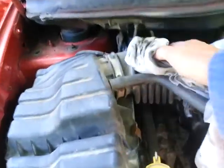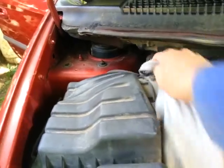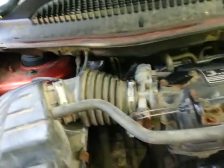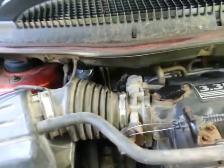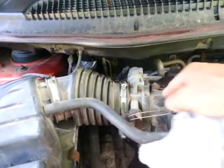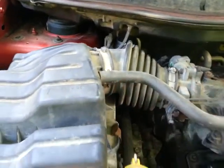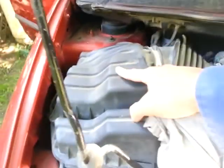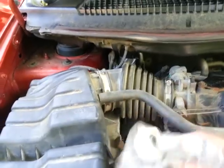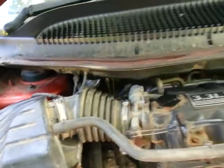So, why do this? Well, here's another thing — the air box here, I want to get this thing clean. I've got some little brushes, I'm going to use those to get into the tight spots. Here's your throttle, here's your engine intake, and here's your air box. If you have to take this apart, all that sand sitting right here and here is going to go into your engine. So if you stay on top of it a bit, do a little bit at a time. Rome wasn't built in a day.